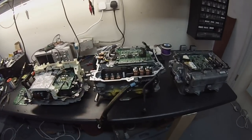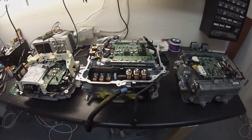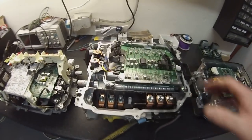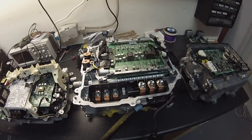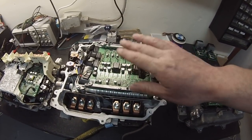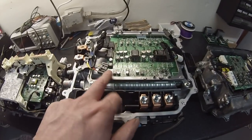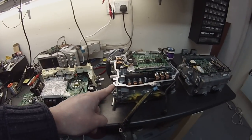In the middle we have our next victim. This one here is a step up — this is a Lexus IS 300 hybrid inverter converter, and you will see here that it's missing its logic board. That's because I have removed and reverse engineered it, and we are currently working on a drop-in board. It uses very simple JST CPT plugs and just screws down to four posts, which will give us the ability to run this inverter.